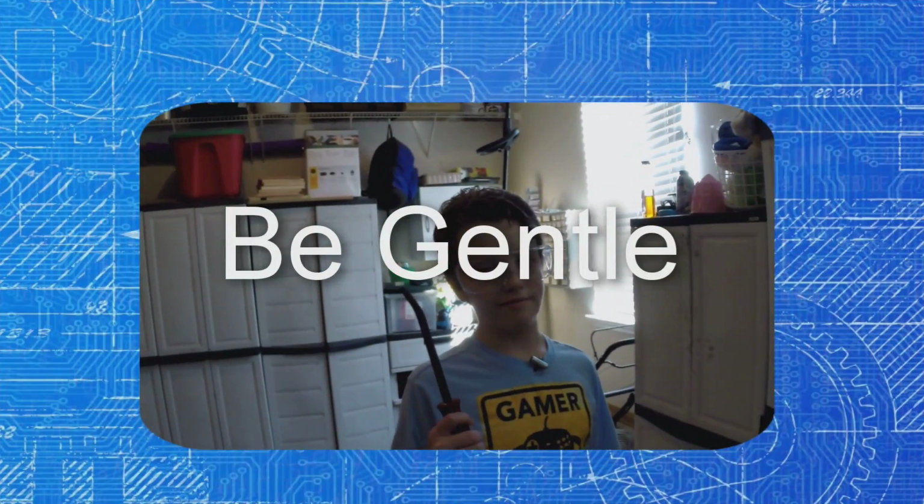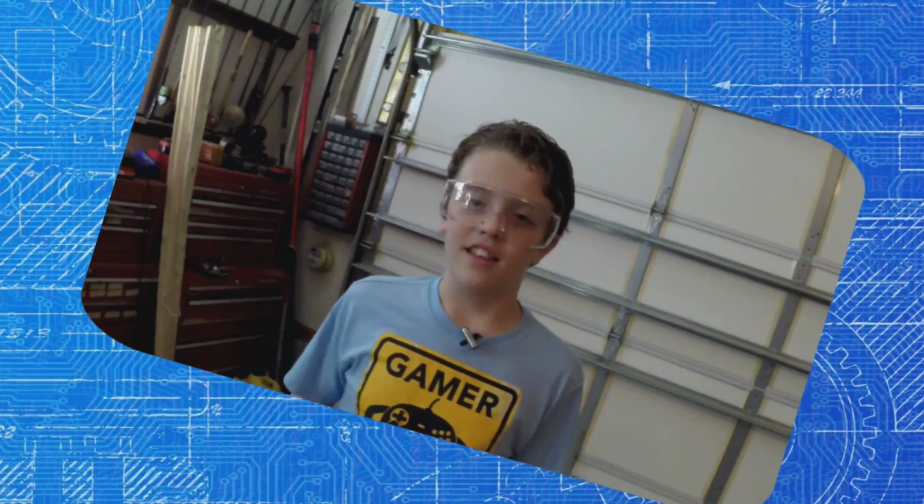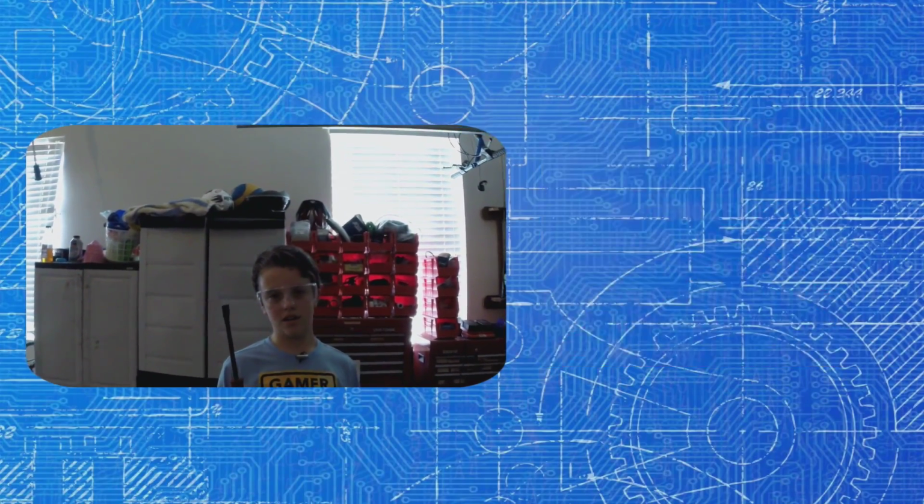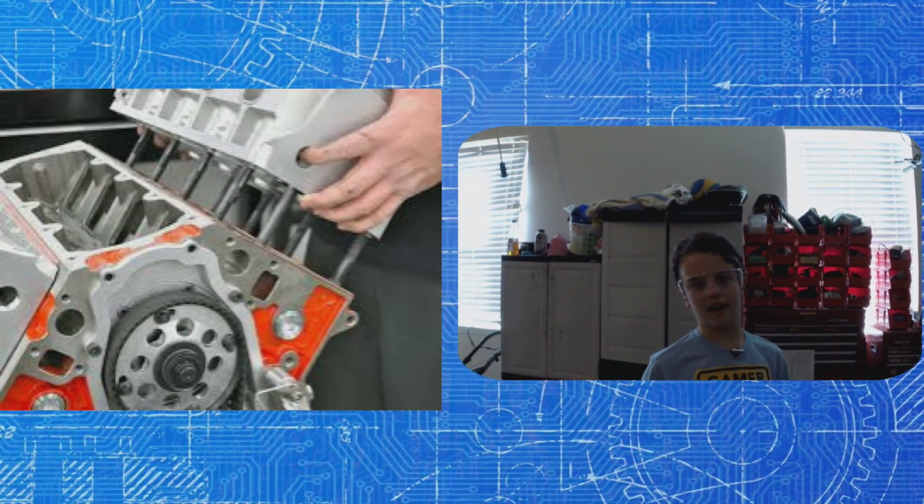Be gentle. A good mechanic never leaves a trace. Nothing is marred or scratched. Never pry a mating surface apart. This may scratch the surface. In turn, it may not seal. Examples are engine heads to engine blocks.